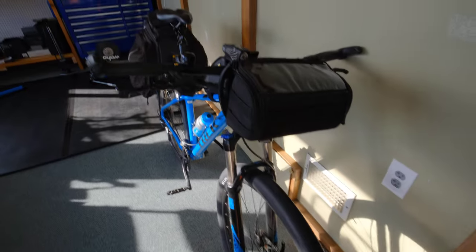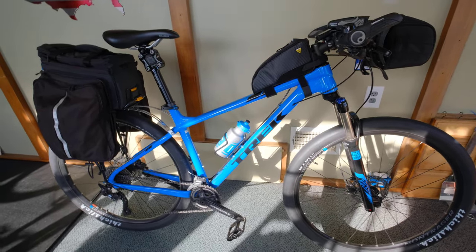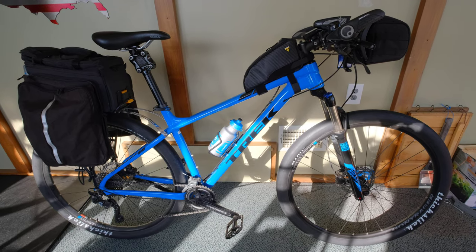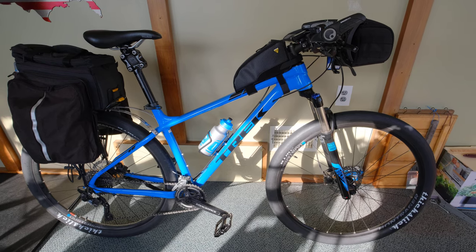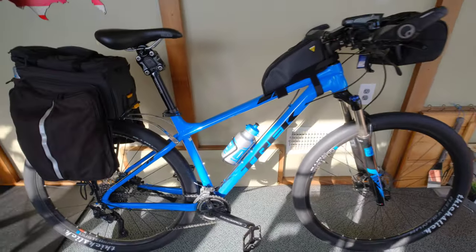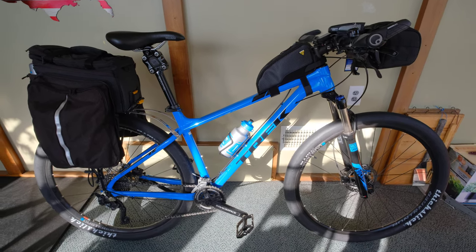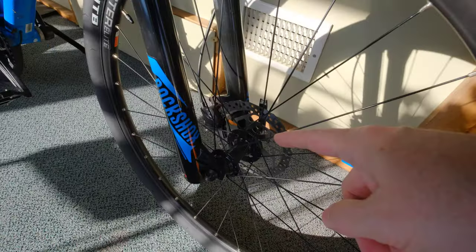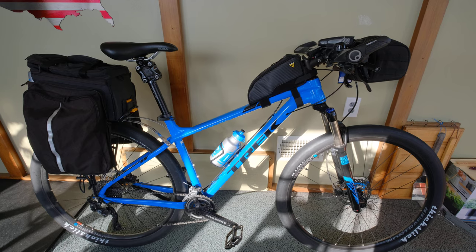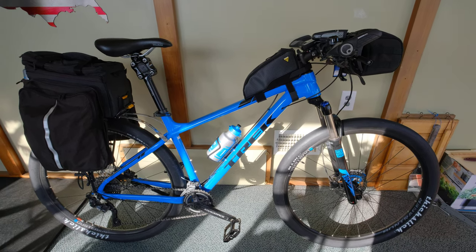I just finished this build — or was about finished — when I got gravel bike parts and was ready to build my gravel bike. So I'm really not going to use it in this touring capacity anymore. I'm going to break it down and turn it back into a mountain bike, because my gravel bike can take over these duties. I just wanted to make this video and show you before I did all that. It came out pretty cool and got a good amount of miles on it. But riding with friends who had gravel bikes, it definitely was not as efficient. These are formula hubs — a loose ball hub — and I don't think they have any grease in them from the factory; they're pretty gritty. The tire is definitely not as fast as a thinner gravel bike tire, and the bike overall is just heavy — about 10 pounds heavier than your typical gravel bike.